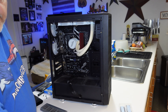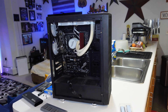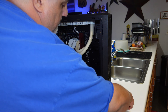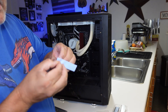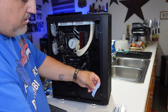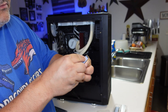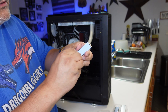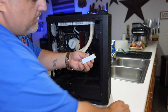I'm going to actually install the cooling pieces properly. We're going to take this SSD and add some thermal pads to it. Grab the first thermal pad — remember it has some stick on it. Pull off the plastic backing to expose the adhesive. We're putting it on the bottom side, allowing it to stick just like that, and then we'll peel off the backing on the other side as well.